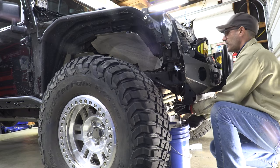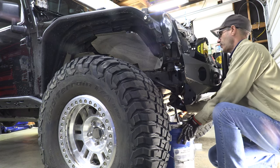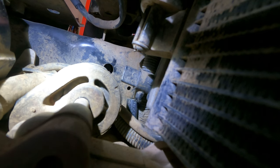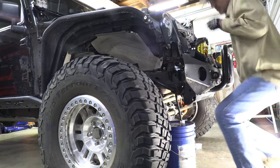Since I'm doing a coolant flush, I'm going to go ahead and drain the coolant from the lower petcock. The way I do that is put like a 3/8-inch fuel line on the bottom of that thing, then turn this little valve and it should start draining.